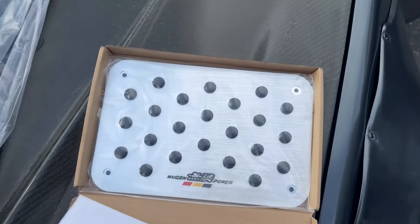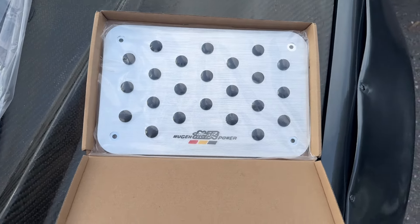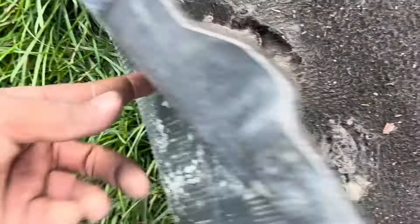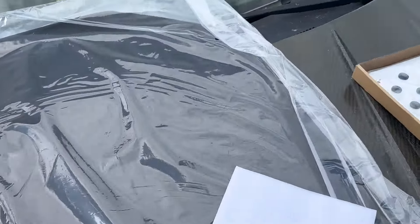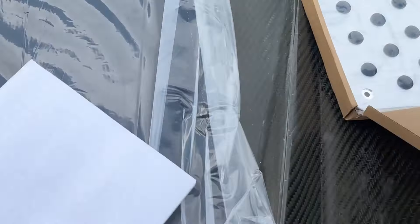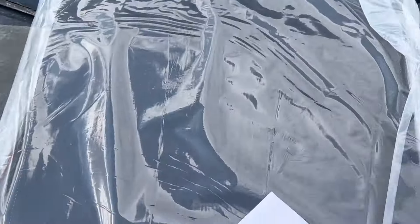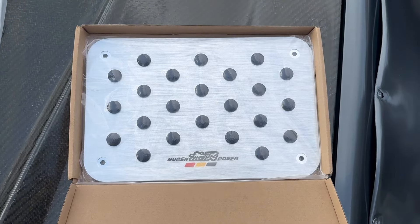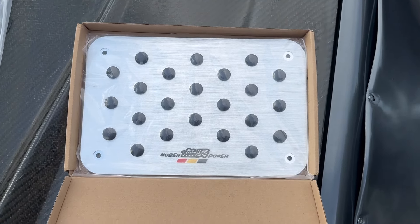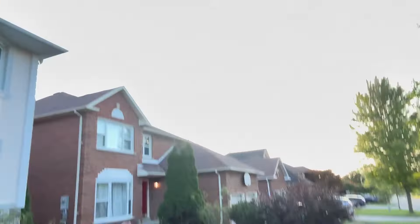The most crucial thing for the interior — this is a heel plate, and it's going to be located right where all the foot pedals are. It's going to help prevent this kind of nasty wear on the carpet. It gets installed on the driver's side mat — just drill some holes and install the bolts and nuts to secure the plate into the mat. That way I don't have to worry about gouging the mat or carpet. Mugen heel plate — this is 150% a must. I advise anyone to get it.